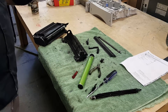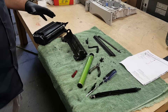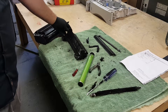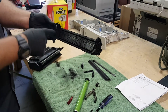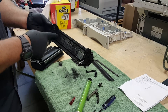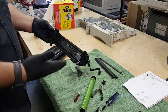But what we see a lot is the waste hopper on these — I've already disassembled this toner cartridge because this is a great example. The waste hopper, which is this piece right here, is going to fill up. As you can see it got a little grungy as I pull it apart, but these will tend to fill up with toner. This is the waste hopper doing its job correctly.